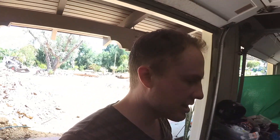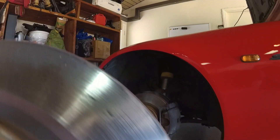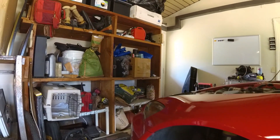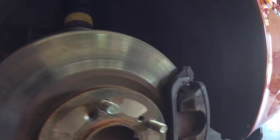Another really interesting thing is the effect that the brake ducts have on the brake rotors. Here I have a rotor that failed — you can see the crack there. But what you notice is that there's not a lot of micro cracks on this rotor, and that's the way that S2000 rotors typically fail. With the brake ducts, on the other hand, you can see there's just a ton of cracks, but the rotor hasn't failed yet and has lasted a lot longer than normal.